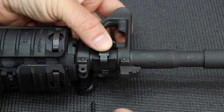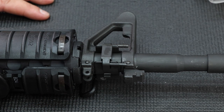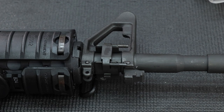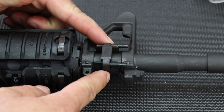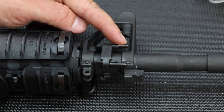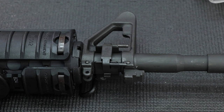All we've got to do is find the best way to get these roll pins started. I'll be straightforward — this is kind of a pain to get installed and you're going to wish you had a third hand. If you have somebody there to help you hold this stuff in place, highly recommend asking them. What I did was take a clamp, go around the back side and clamp the two pieces together, because they want to fall off and move around when you're trying to put these pins in.